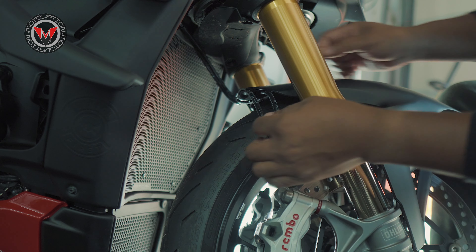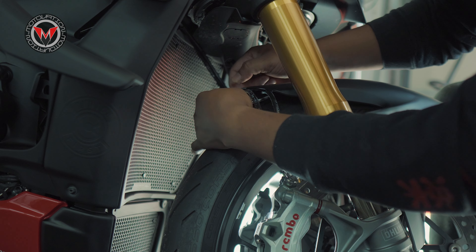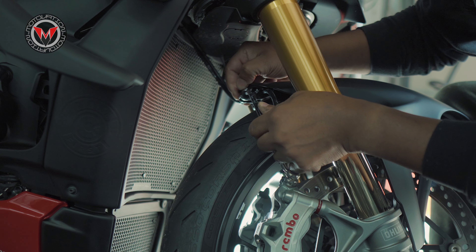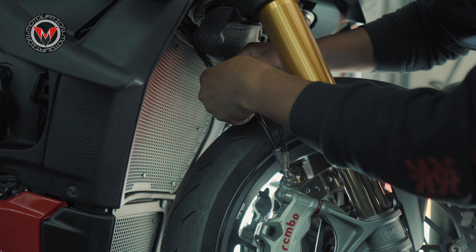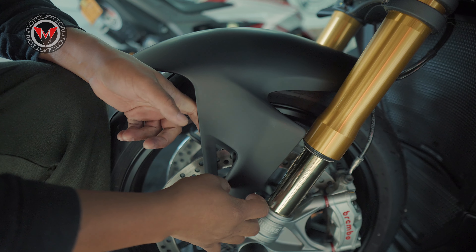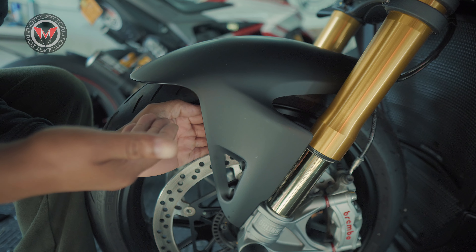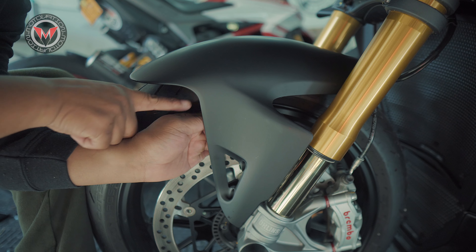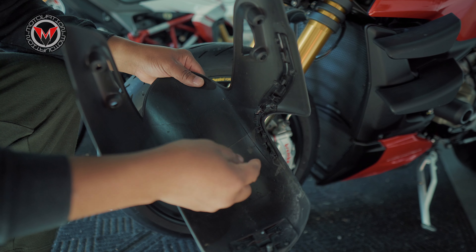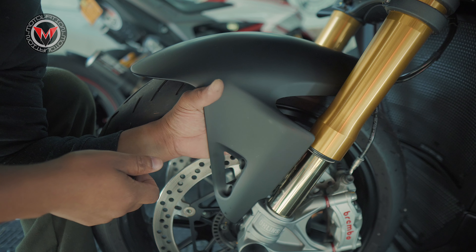Now that we have it out, there should be an underpiece here. As I'm pulling it up, you're going to reuse that. Now we're going to undo the wiring carefully before pulling off the fender. The trick to doing this simply without guessing is to look underneath the fender right here — see where the wire exits out of the hook.